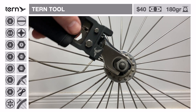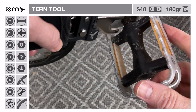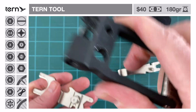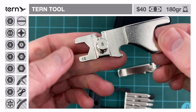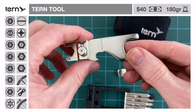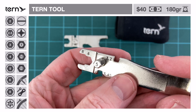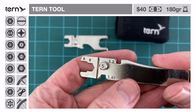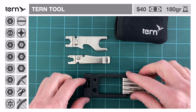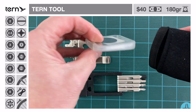The 15 mm wrench can be attached on the side of the main tool to provide extra leverage when removing difficult nuts. This leverage is particularly important when extra torque is required, for example when removing a pedal. Additionally, the lever can be used for 10 mm nuts, 4 mm spokes, and as a bonus, a bottle opener. This is also where the 8 mm Allen key is located. The second lever includes a 6 and 8 mm open wrench and two additional spoke adjustment notches, of which the 3.2 mm notch is compatible with Brompton spokes. The embedded 5 mm key is also used to activate the chain breaker tool.